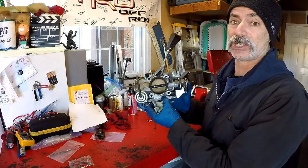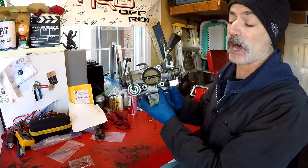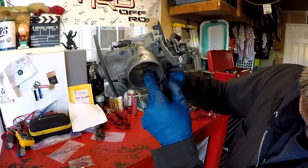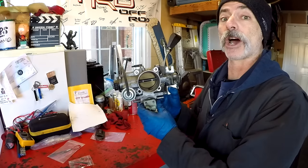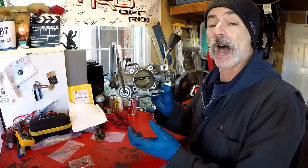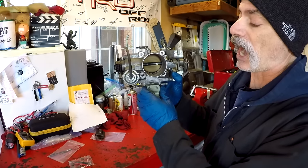When an electronic fuel injected engine is idling, the throttle plate is closed, so the engine needs to get its air from somewhere — that's where the IAC valve comes into play. There's a hole on the front side of the plate. The idle air control knows to open based off different sensors: the coolant temperature sensor, the throttle position sensor, and the AC switch — because when AC is on, the idle is higher since you're turning the compressor. Various sensors control the opening and closing of the IAC valve.